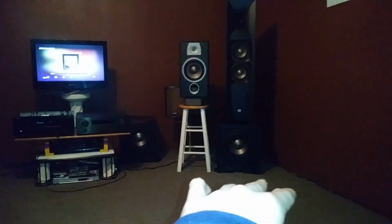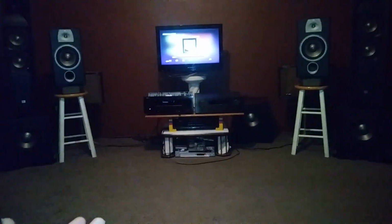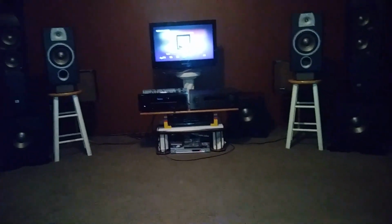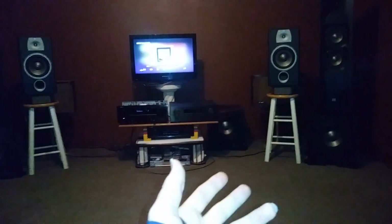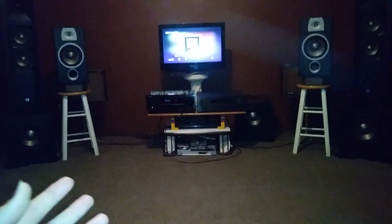And those also, probably don't worry about trying to get those. This speaker series, don't worry about getting the matching subwoofers, because you may or may not like the acoustic suspension, because it's different. It's not like a real movie theater. All real movie theaters use a bass reflex sub, because money is the name of the game, honey. To have an acoustic suspension subwoofer in a movie theater has to be way more powerful, way more expensive. Run for your electrical bill to be able to handle the enclosure being sealed. They make them bass reflex in the theater because it's efficient.